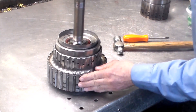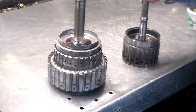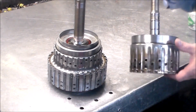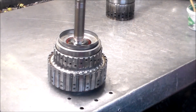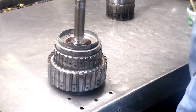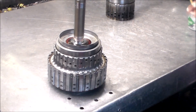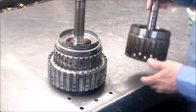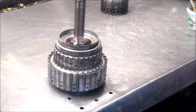Just to recap: 2012 Ford F-150 with a 3.5, 6R80 trans came back — probably did this maybe six months ago, maybe a little longer. Came back with no fourth, fifth, or sixth. Found the E-drum cracked, got a brand new one from Ford, and there is a core deposit so they want the old one back. Going to put this back together and get it back in the car. Everything else looks good — went through the rest of it and all the other clutch packs are basically new. When I did check this drum at the time I check every one of them, the drum was good, but six months down the road the drum developed a crack. That's it — thank you guys, watch it, have a great day, see you next one.